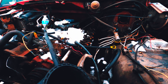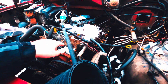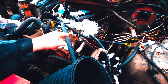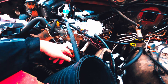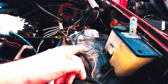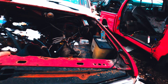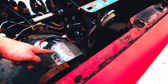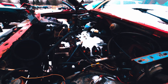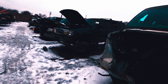Here we have the big boy — this is a 460. If you didn't know, out of the common big blocks — the 440, 454, and 460 — this one can go to 514 cubic inches without grinding or anything at all. Somebody cut the Duraspark box out — those are pretty valuable nowadays because the aftermarket reproductions aren't great. This one's smashed and full of corrosion, but if I wanted to build a big block on a budget, it would be a 460 Ford.